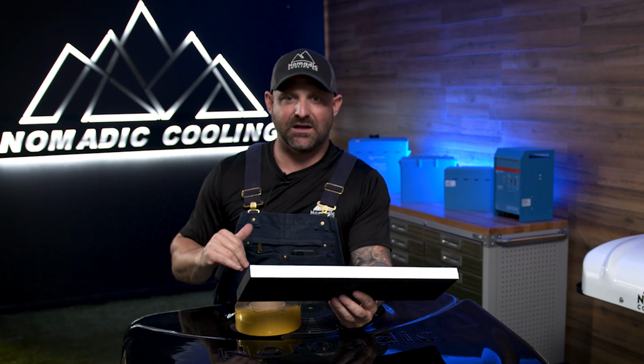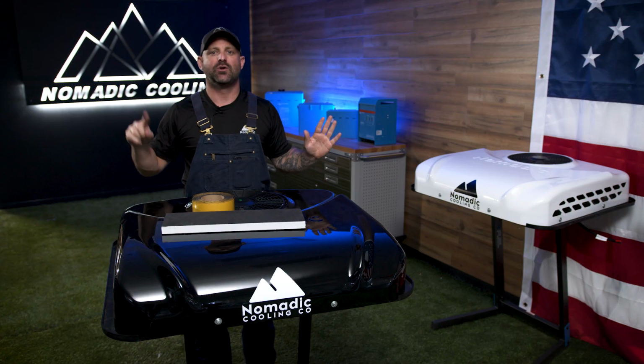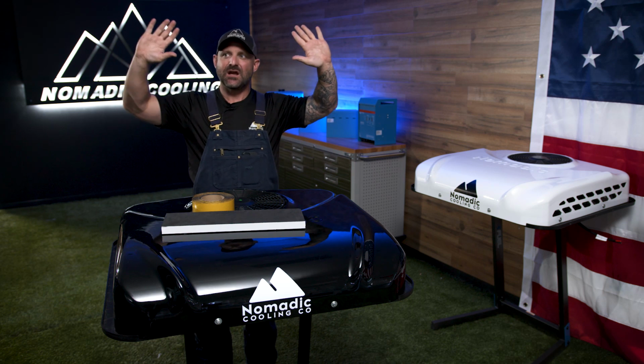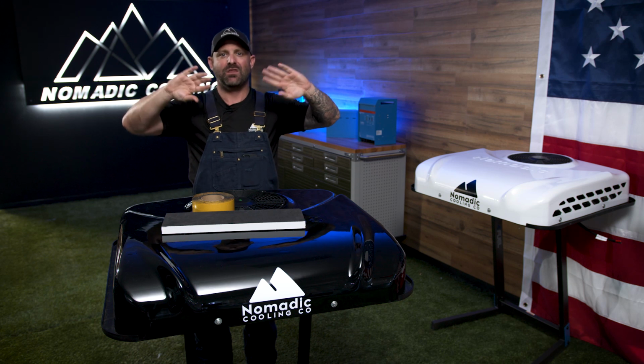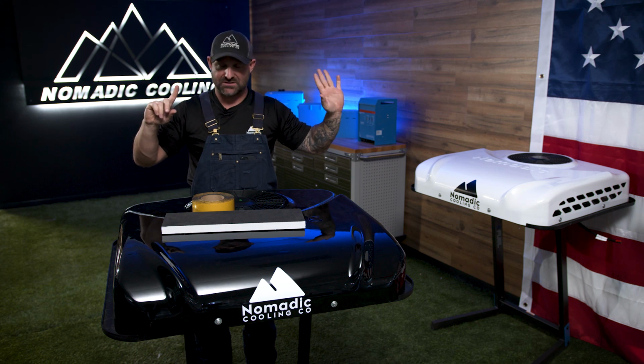If you got your van built by a builder or by somebody else and you are now getting your van secondhand and you pull down your interior vent and you look up there and there's nothing separating the hot air from the cold air, I am telling you your air conditioner will not be working very well, and then you're going to go tell people that your Nomadic Cooling air conditioner sucks. We don't want that. We want to test the air conditioner without the interior vent up there. You have to remember that is basically just aesthetics and it holds the control panel in place.